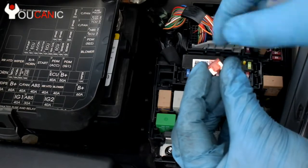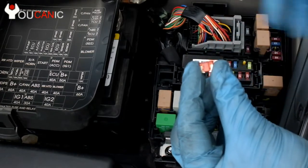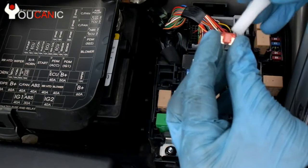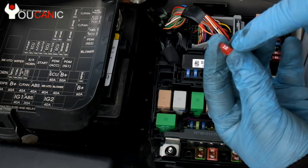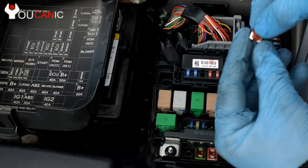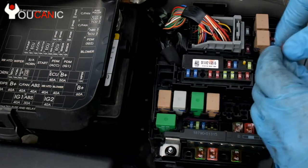And there is the fuse. So now if you look carefully, you'll see a wire in this fuse. If that wire is disconnected, you need to replace it. Always replace it with the correct amp rating — so in this case it should be a 10 amp fuse. Never put a higher amp, so don't put a 15 or a 20 or anything higher.